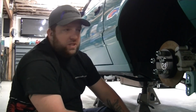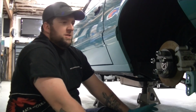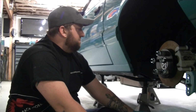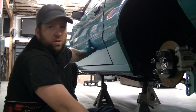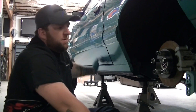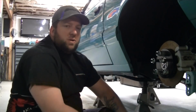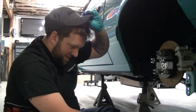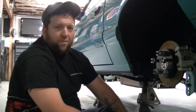Now, obviously I have slicks on the car, but those are just tires to roll around. This will be a radial car. Same goes for the instant center. It's completely backwards for the two. So on a radial car, you want the long instant center to keep it out further. If you can get it to the front wheels, great. 45, 50, 60 inches. It's going to help keep that separated as it's going down the track and keep the tire planted but the body separated, if that makes any sense. I'm not a professional in this subject. I've only read what I've read.